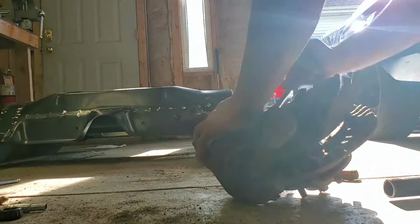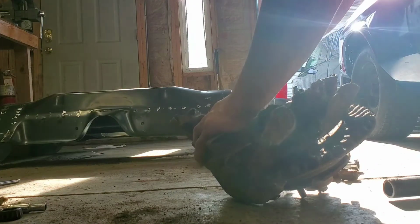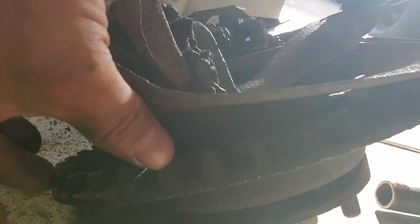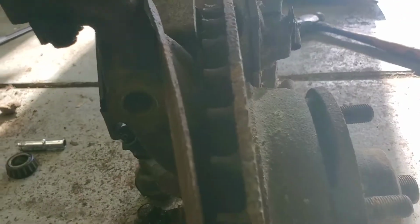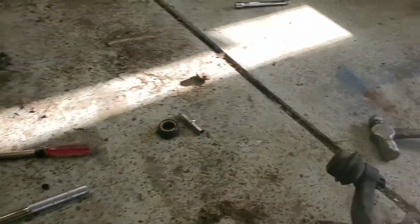And remember, I'm not really sure if you guys saw it, but this rotor was broken. So ideally, you would just have to compress the caliper piston in a little bit to free it from the rotor. Let's see if we're able to, because this is the rotor vanes, which should have a contacting surface on both sides where your caliper piston pushes your pads. So what I'm going to do is see if I can hammer it up and free it out. I'm just going to show you what I'm talking about, but you're not going to be able to see me actually take the full swings that I should be. That's what I will be doing to get this caliper off. I will show you guys and resume shooting once I get it off of there.